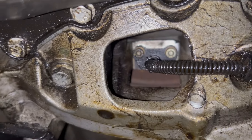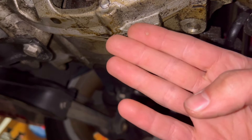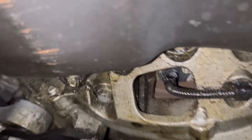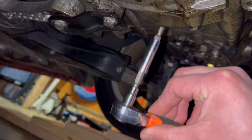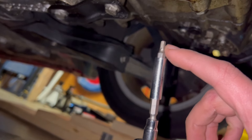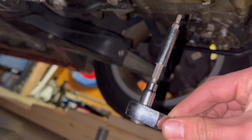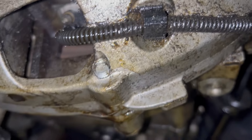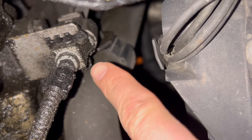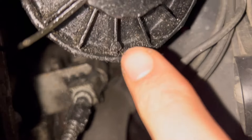You can see there are two Allen head screws up in there. This is the engine side, but right here is where these bolts are. This is the transmission side directly over here, but this is the engine side. I found a 4mm bit — I don't have my metric Allen pack at home — on a kind of extension setup. There's also a little clip I need to unclip, and then I'll plug in the new sensor wire. The connection is right near the oil filter housing, for reference.